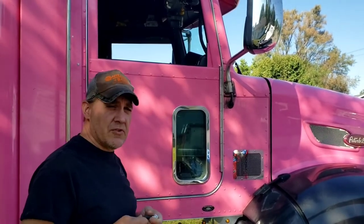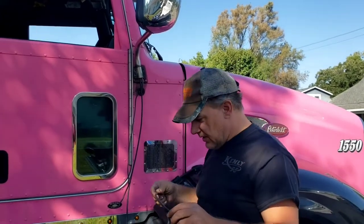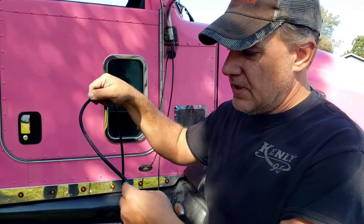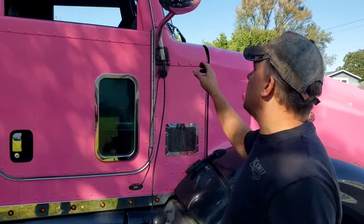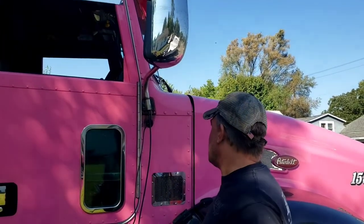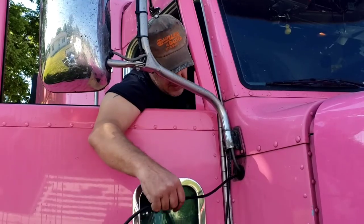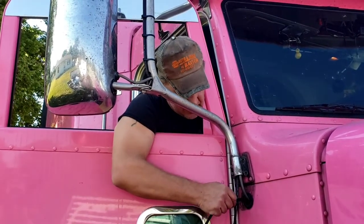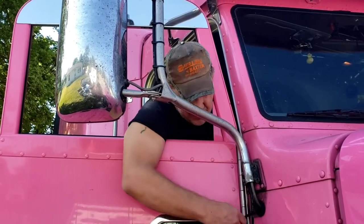Let's get this done and we'll get it wrapped through here. Be very careful when bringing it through here - this was a little temperamental. We got into the shielding a little bit sliding it through, actually hit the metal right there. I'm gonna have to tape that up once we get it inside. Getting it in - once you do, you just have to make sure you feed it carefully through the hole and don't scrape the sides. When you feed it in, grab onto that line coming out of the glove box rubber grommet and feed it at the same time to prevent it from binding, since you're going up at a 45-degree angle. Use both hands.